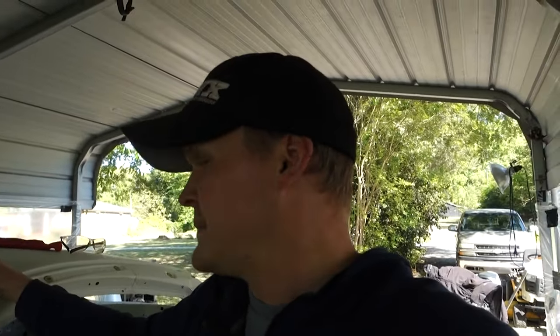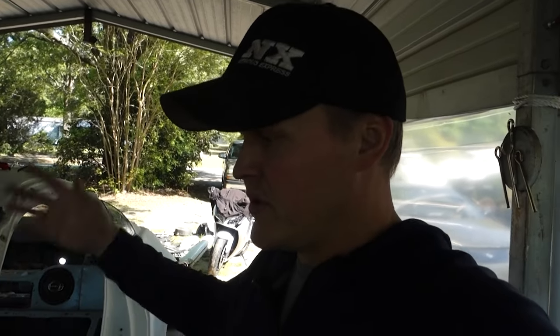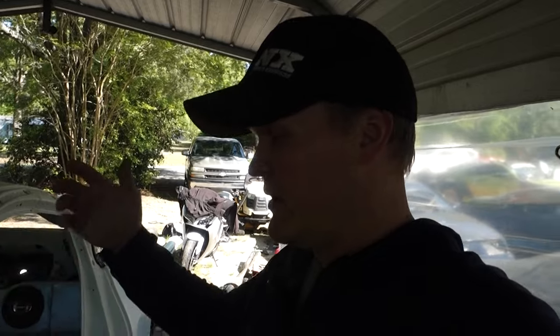That's pretty much where we're at with this thing. I've got a little bit more sanding to do — actually a lot more sanding, because I have to sand the front bumper, back bumper, doors, fenders, all that stuff. None of that's been touched. I'm not really a body guy — can't stand sanding — but we'll get through it. The main goal is hopefully by this weekend, I can get the chassis completely done: the undercarriage painted with a rust inhibitor, and get the engine bay, roof, and whole chassis painted in one shade of white so I can start taking the crashed HR car apart and switching everything over.